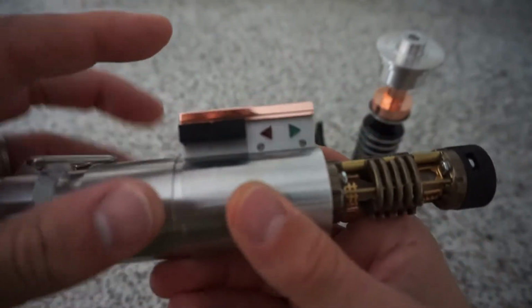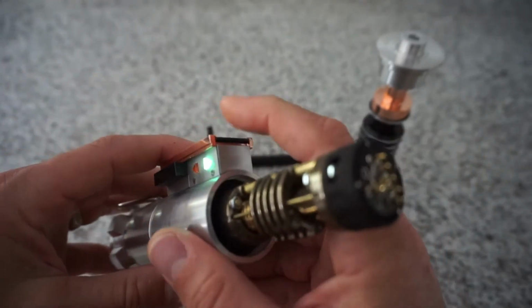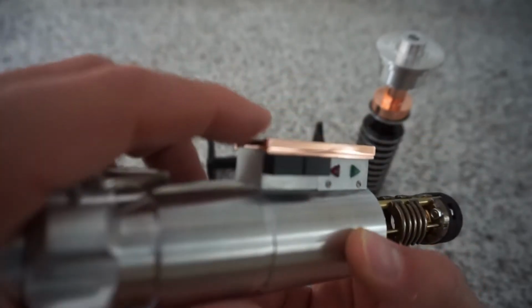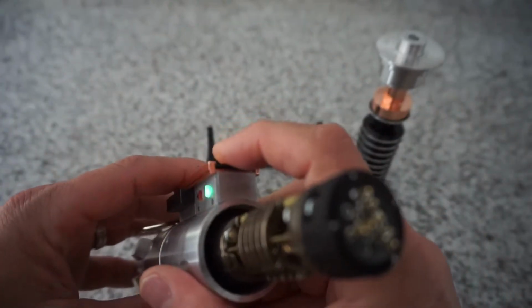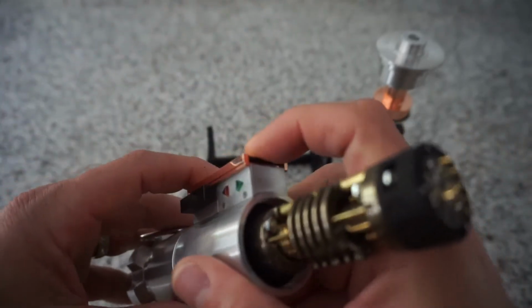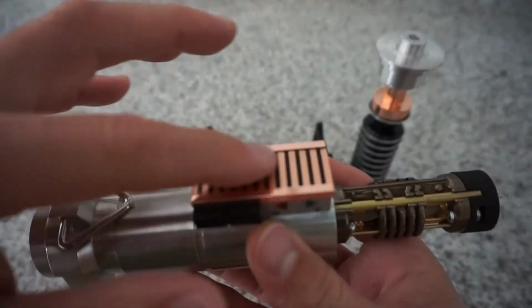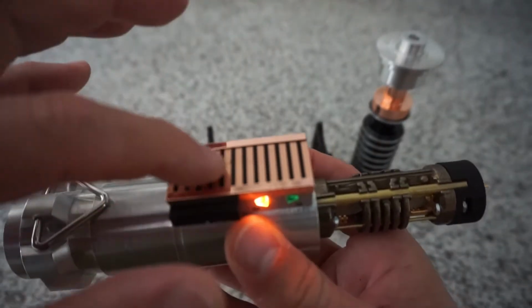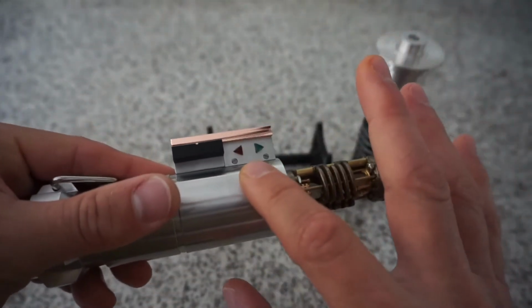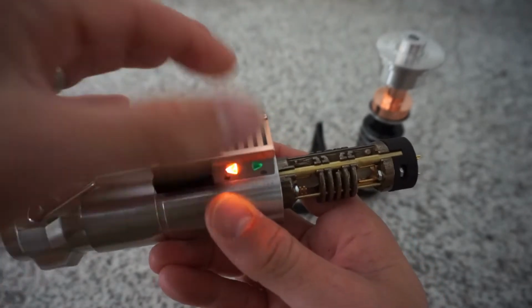And also, it lifts up the middle of the clamp board just a little bit, which makes it sort of like a seesaw, which allows the top of the clamp card and the bottom of the clamp card to get a nice press down on the buttons. With that said, you can remove the clamp card and slide that out of the way. There'll be 2 screws, which are used to hold the control box to the hilt. If you slide that out of place and take those 2 screws off, you can remove the control box.